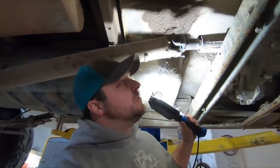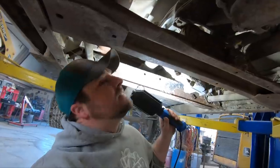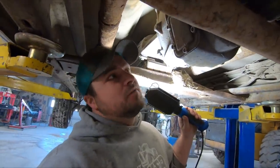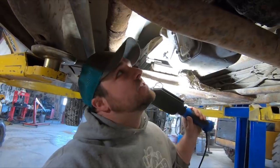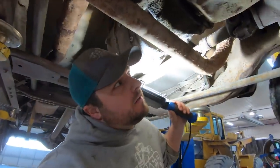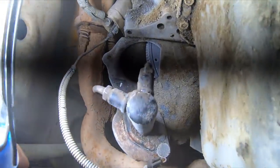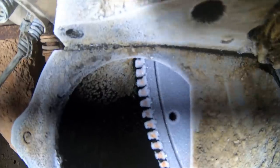To do this I've got to take the driveline off front and back. I might be able to leave the transmission in and shift it back enough to get the flywheel out, or I might just pull it all the way out. I need to take the shifter up inside the cab and remove the bolts to the bell housing. In here you can see where it's all chewed up — the ring gear and starter just didn't like each other.